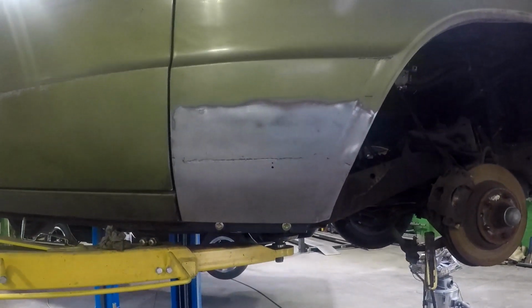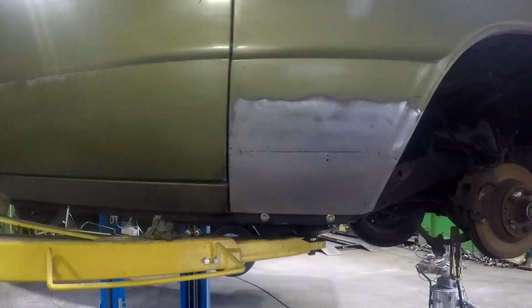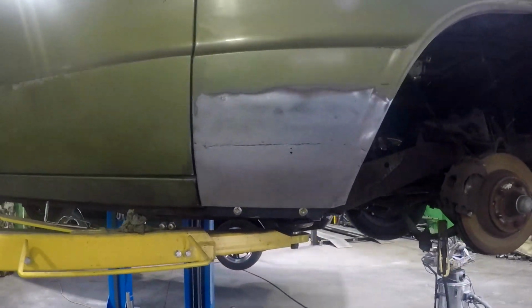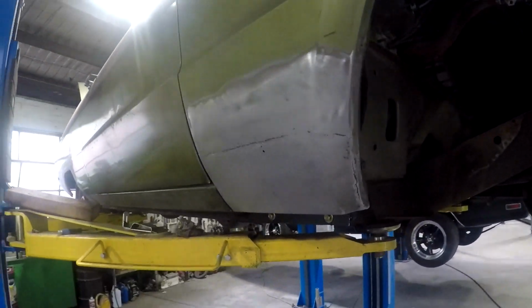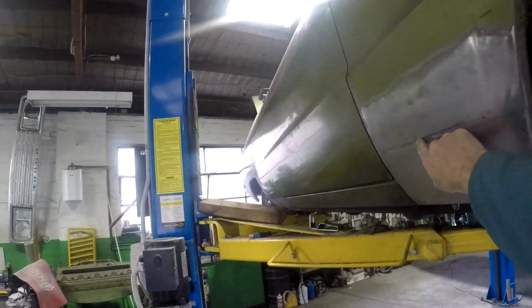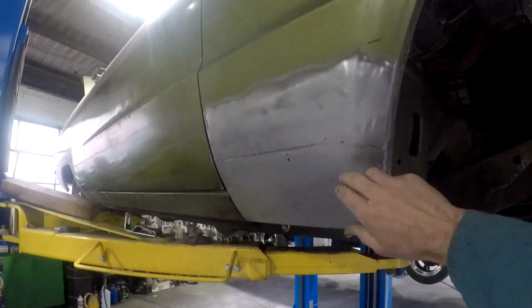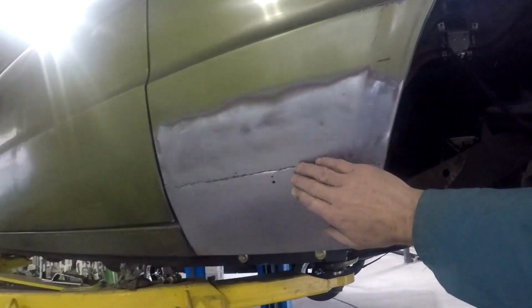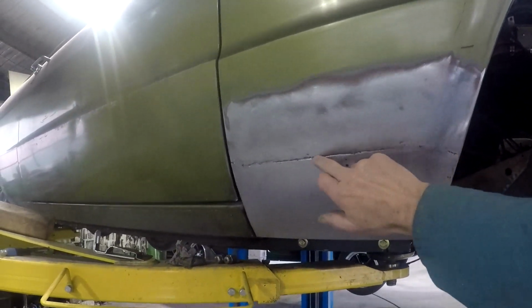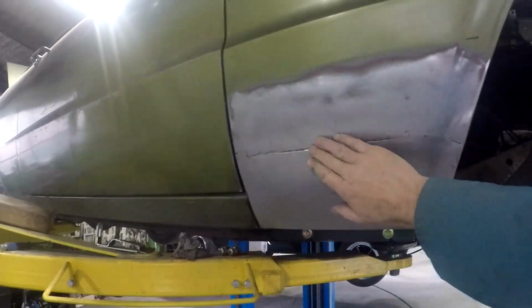It's looking good. End result, fits up perfect. I was able to spring the gap slightly, like I said, after I bolted it up, finish once it was all welded. Little line down the bottom corner and a tiny little line, more of a mark than anything else. I could keep grinding the crap out of that and make it all shiny, but all you're doing is making it really thin. So when you weld along a distance like that, it always pulls a little bit, so there's a slight little low spot in the middle, which would be ideal.